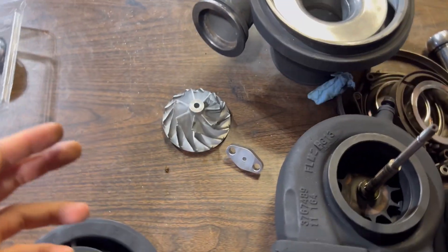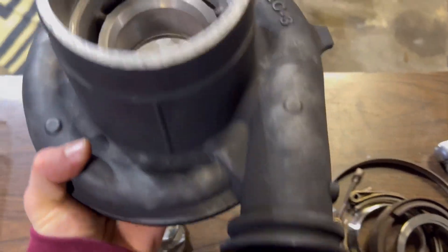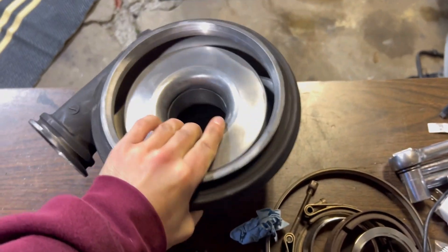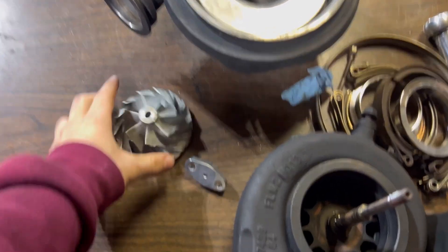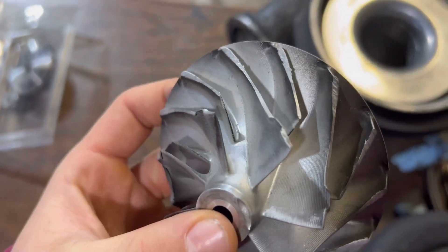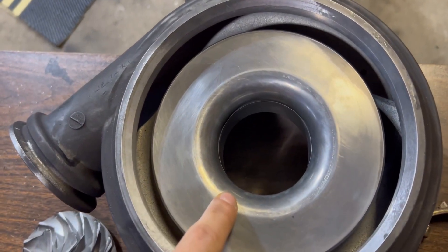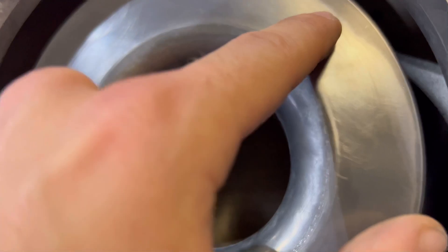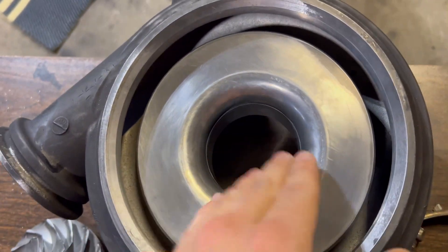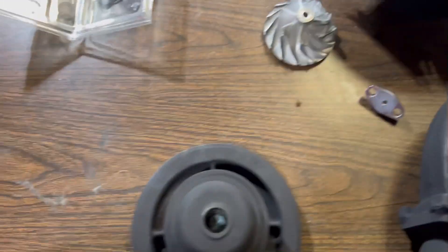A lot of the parts are interchangeable between the HX-52 on my truck, and I'm going to replace it with the HX-55 front compressor housing — that'll allow me to run a 67 millimeter comp wheel. I ordered a new one; this one's a little messed up. You can see there are some little divots there, but it was much worse before — I gave it a little sand with 1000 grit and then 2000.